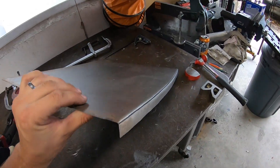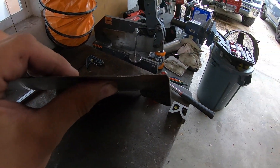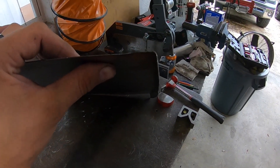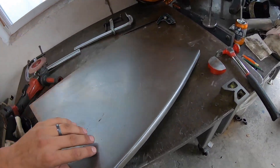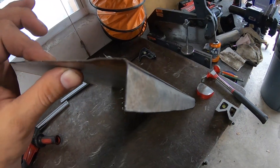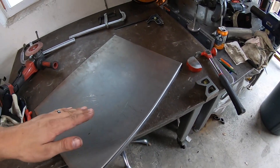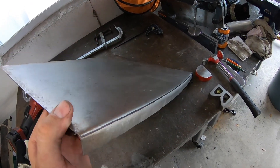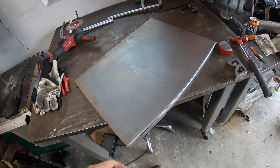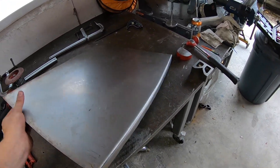We've been hammering a little bit and we got this looking pretty good - it's just about 90 degrees so I'm going to give it a test fit to see if the radius works. It actually worked out well because when you're bending along a radius you have to shrink it a little bit, but what this does is it bowed the panel up slightly, which is actually something we wanted because it bows like that in the car.